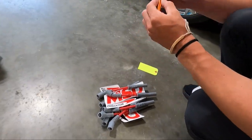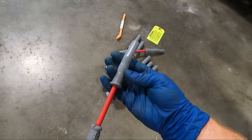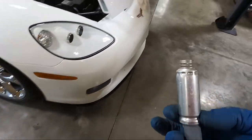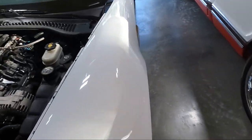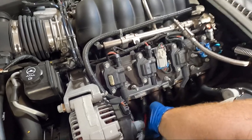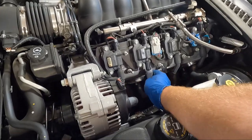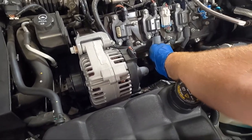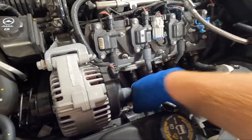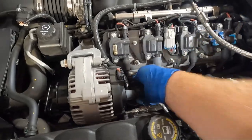On these I wouldn't even mess with those labels - you can label them if you want, I don't ever use those. These right here - see the ends - you can bend them so they can face a different direction. So what I generally like to do is put your little boot on and then put it on the car, listen for it to snap, and you can bend it just a little bit. Now we're not touching - we're on and we have enough bend there to stay away from the header, so it's not sitting on it. So all in all looks pretty good. We've just got seven more of these to do.